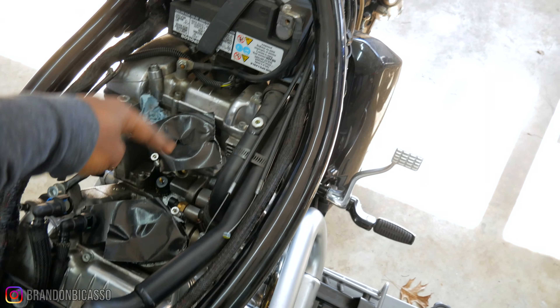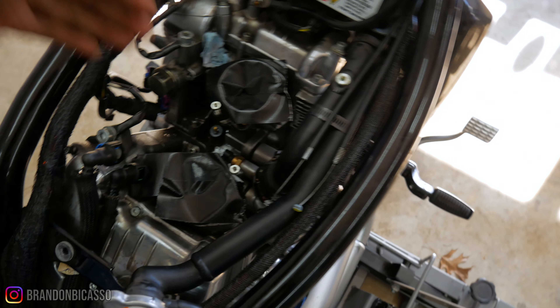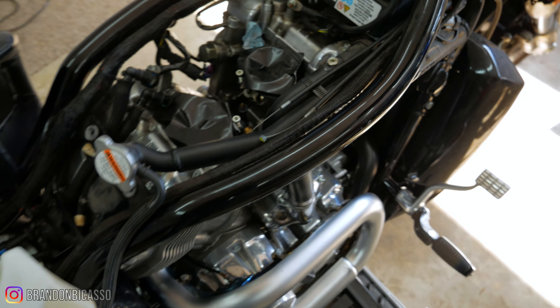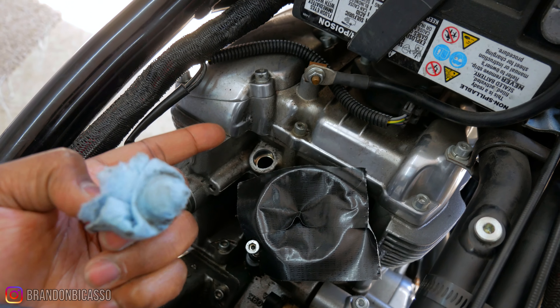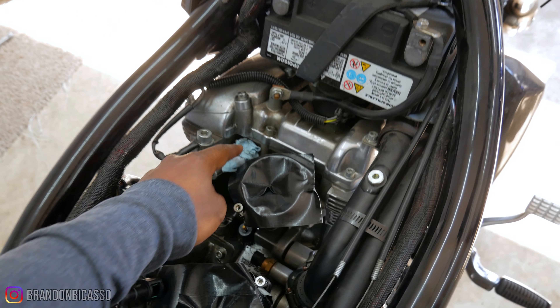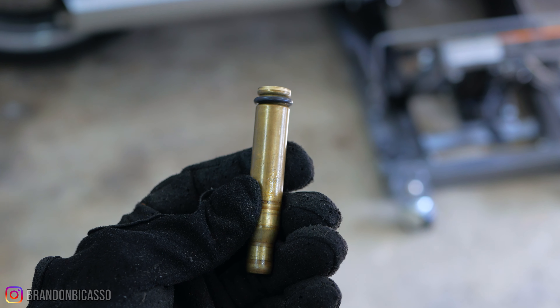In this video I want to briefly talk about the parts associated with fixing this and the whole idea of the Harley tax. Right now this is where my V-rod is — I have duct tape over these air ducts. If you were to take those ducts off, you're looking directly into the intake valve inside the cylinders, so obviously you don't want anything getting in there. The whole thing that caused this oil leak — you can see oil all down in there — is this breather port. There's a gun-casing-looking device that goes in that hole, and the o-ring rounded and the breather tube that connects it to the airbox is what leaks. The fix is somewhat easy: replace the port, make sure it's secured, change the o-ring and the tubing over that assembly part, and that essentially fixes the leak.